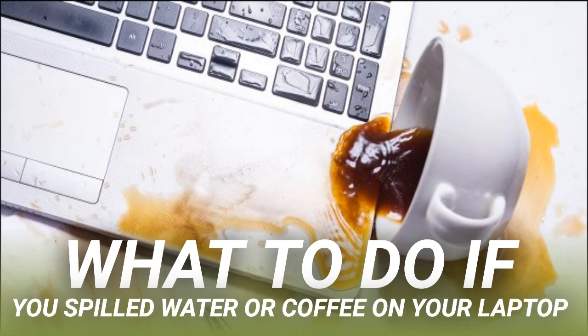The best fix for sticky keys is to clean the individual key switches. On some laptops, you can pop the keycaps off fairly easily to get to the mechanism beneath. You can use some isopropyl alcohol spray and a cotton ball to remove even the most stuck-on gunk — the alcohol will quickly evaporate. Before you try this, make sure your laptop is turned off, unplugged, and that any batteries are removed. If possible, spray or drop some isopropyl alcohol on the affected keys, then press each key repeatedly to work the alcohol into the mechanism. The more you press it, the looser the key should become. Don't use too much alcohol, though, or you might wash the gunk farther into your laptop. Repeat this process until the keys aren't as sticky.